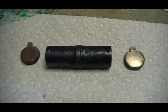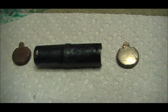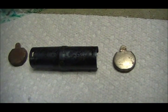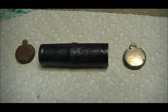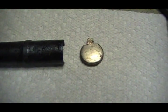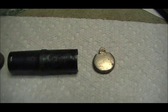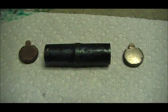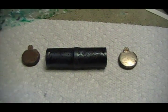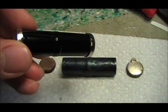Last thing to do in this step is to finish up this air tank. It just needs a quick cleaning of rust and paint with the wire wheel, and then a recoat of gloss black. And then these end caps need to be cleaned up and polished and coated. And if any of these are ever damaged beyond repair or missing, like one of them was on my car, reproductions are available.